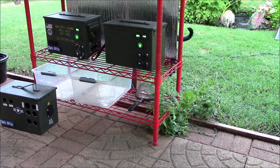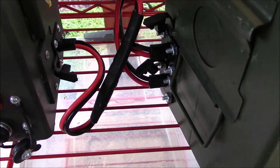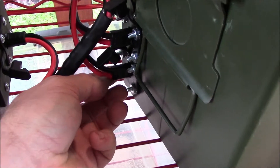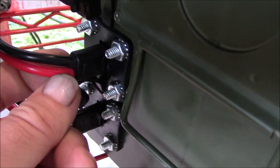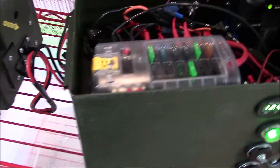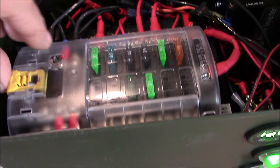Here it is out back — there's the old one up there now. Here are those SAE connectors: battery-to-battery paralleling cable, quick disconnect, and the screws to hold those jacks in. I put those on that side because I didn't want them to poke the battery on the inside of the box. Here it is all wired up doing the arky-and-sparky test.